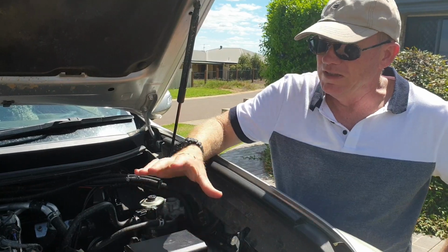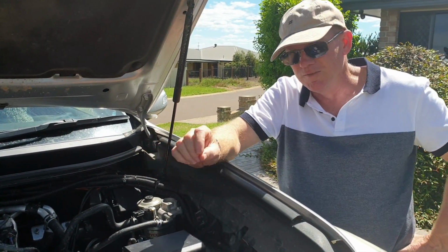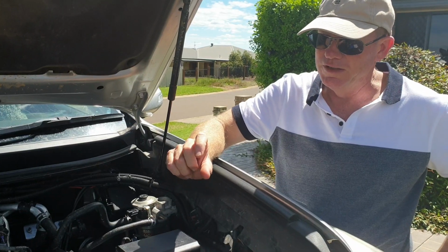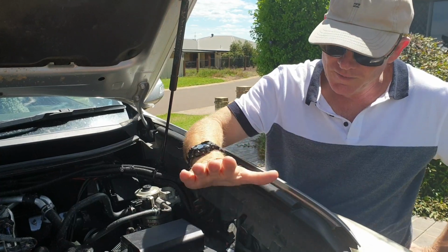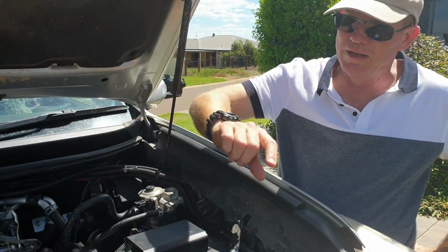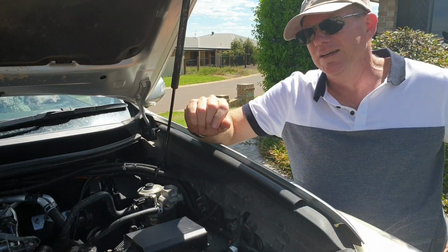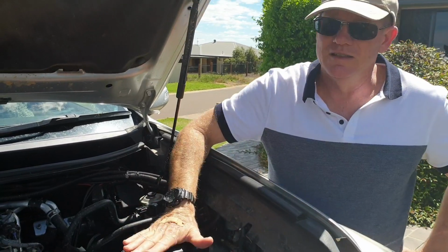So the other thing, what we used to have before, and with the Prados, they have a smart alternator, so it wasn't really working efficiently. But what we did initially when we put the battery in is we used one of those solenoids to connect the two batteries together. So when it got up to the operating voltage for the main battery, it then charged the second battery. As we all know, with the newer cars, the smart alternator doesn't really charge the second battery efficiently, and you've got to go and get a DC-DC charger.